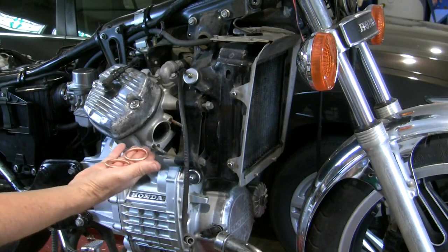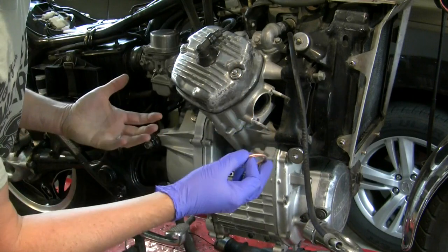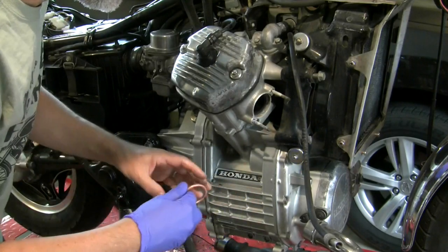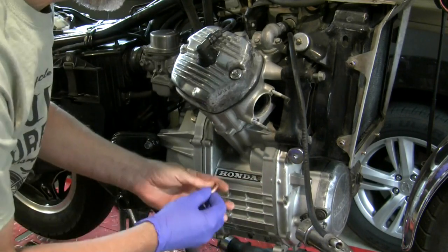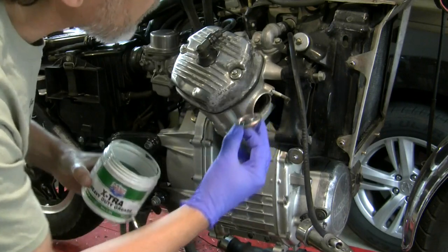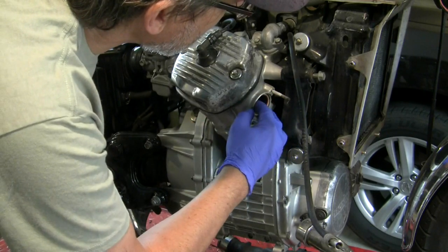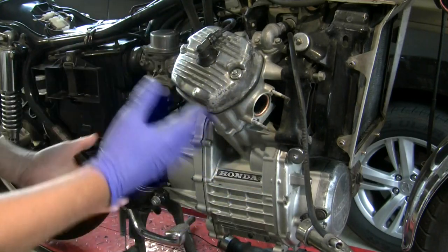As long as they fit, I've got one for each side. Here's a little tip: these exhaust gaskets, when you're trying to put exhaust in, you're juggling multiple points. You want this gasket to just be in there and stay in there, but of course it doesn't want to stay because of gravity, and you can't hold it on the other end either. So here's my tip: just dip it in grease and get the thing sticky — the grease will hold it in there. On first start it just burns off, but it's one less thing you've got to hold on to while you're doing the process.